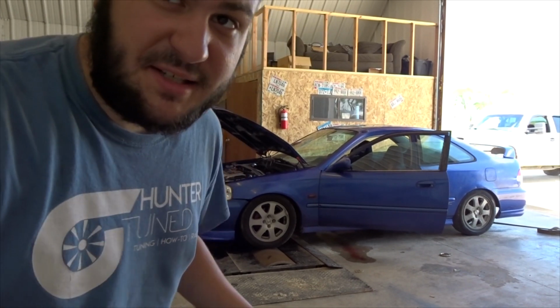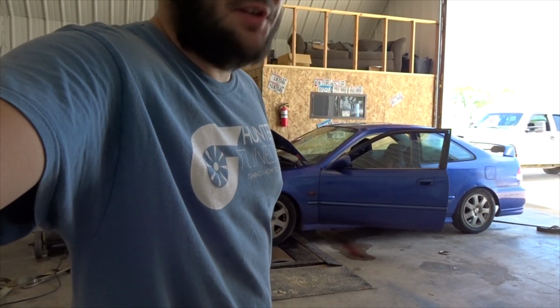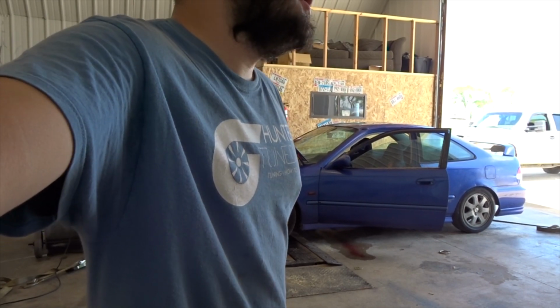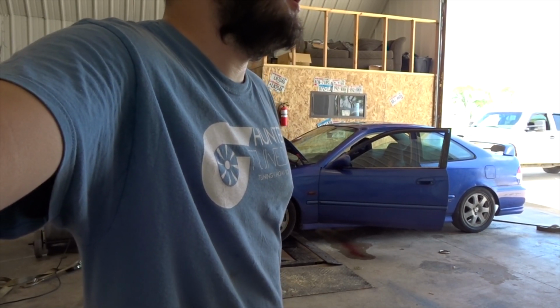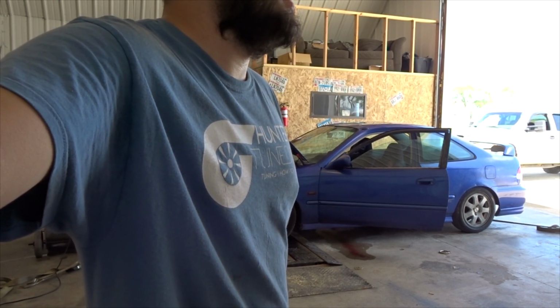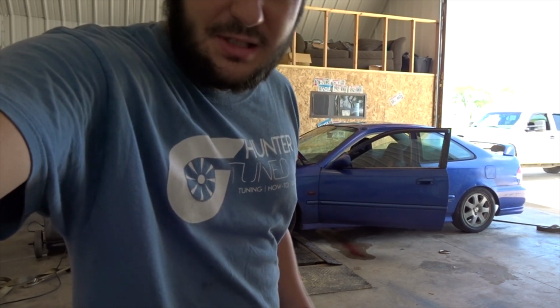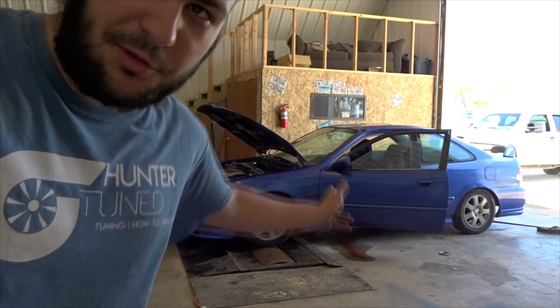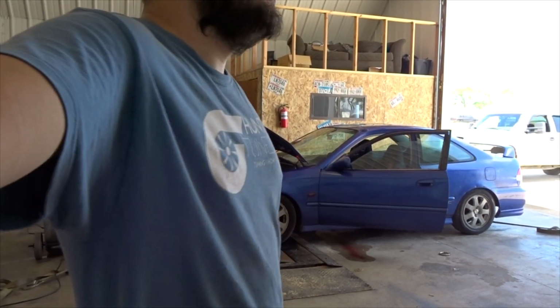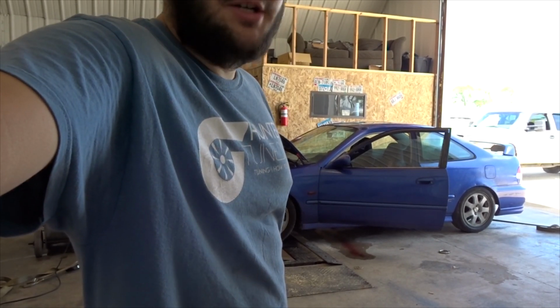So this thing is a B16 transmission and it's pretty short geared, but 4th gear was a lot happier on the dyno for sure. 289 horsepower, 226 foot-pounds of torque. The torque was reading a little bit higher in 3rd gear because the load was less with the 3rd gear in the B16 transmission. Horsepower outputs are usually the same regardless of gear ratio.